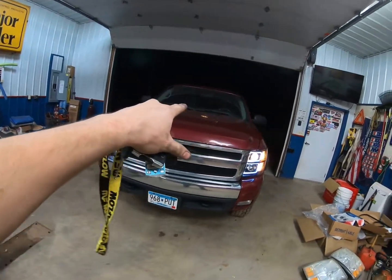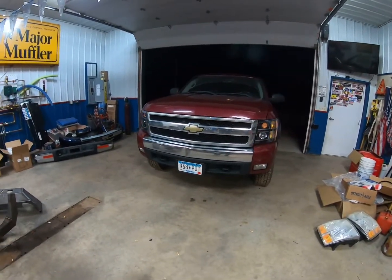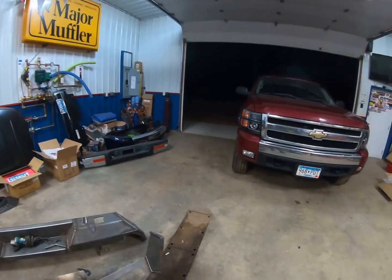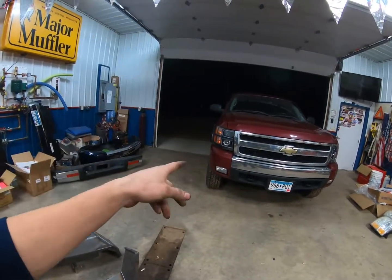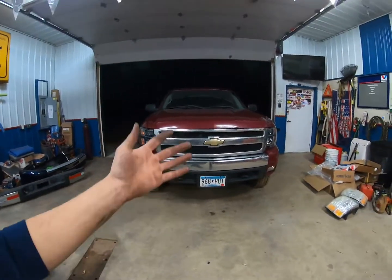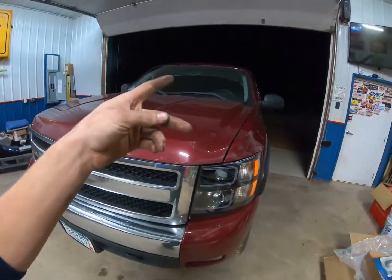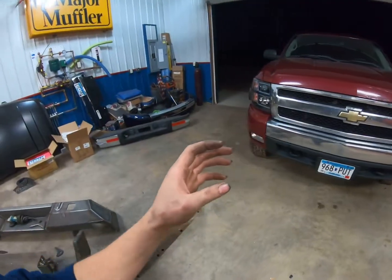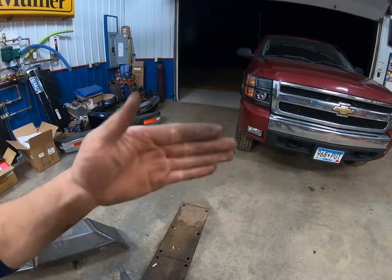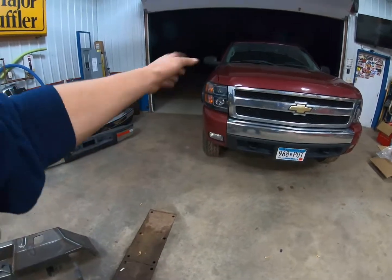That was through 10% over factory tint on the back window of this thing. So that was through like, I don't know, 8%, I don't even know what you want to call that, but yeah, they still lit up that bright. So I definitely need to get switchbacks, some LED H1s, like probably the same that are in that thing. Probably will run into the same issue. I don't know, I'll look, but on that one, I tried to get some bigger headlights, and when I put them in where the headlight goes, the fan on the back was hitting the frame or whatever, subframe or core support.